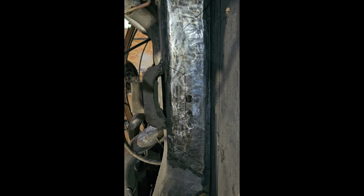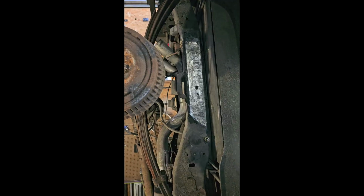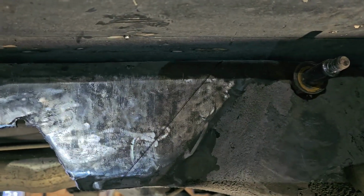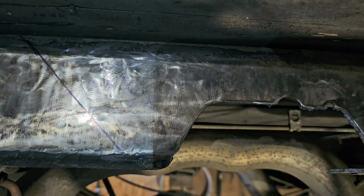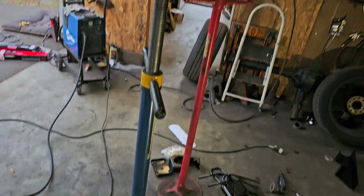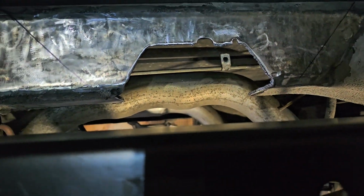And we're only lifting this bed about 2-3 inches. Just enough to get my welder inside of there in a minute. Other than that, I'm going to go ahead and whack this out. I can't really hold my phone and do it, but I will show you how it looks when I'm done. Right, and I like to leave the bed low at first, so it holds it nice and tight to the frame. And then we'll raise the bed after this so we know we got a flush mount and the frame is not twisted. I do have these long jack stands set up where they're not pushing up nor dropping down. Well, bear with me. We'll pop this on and we're going to weld it.